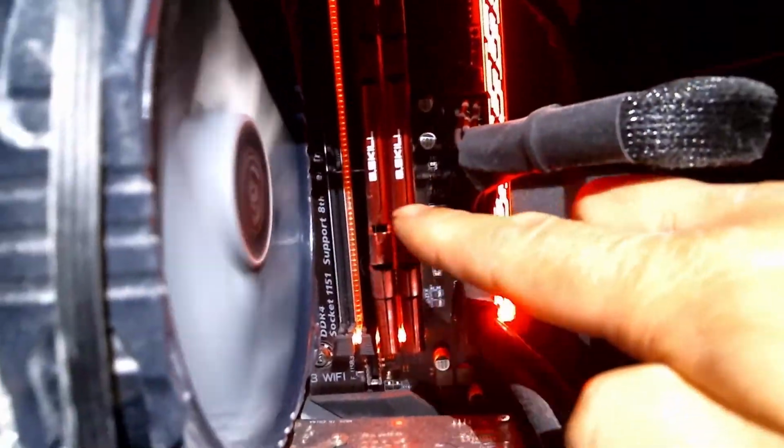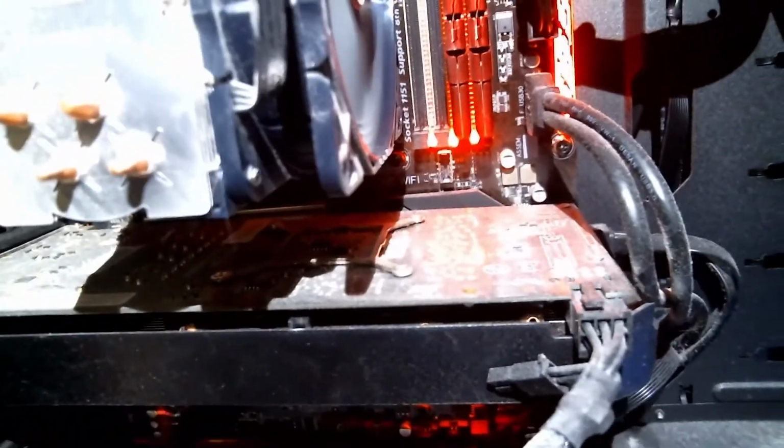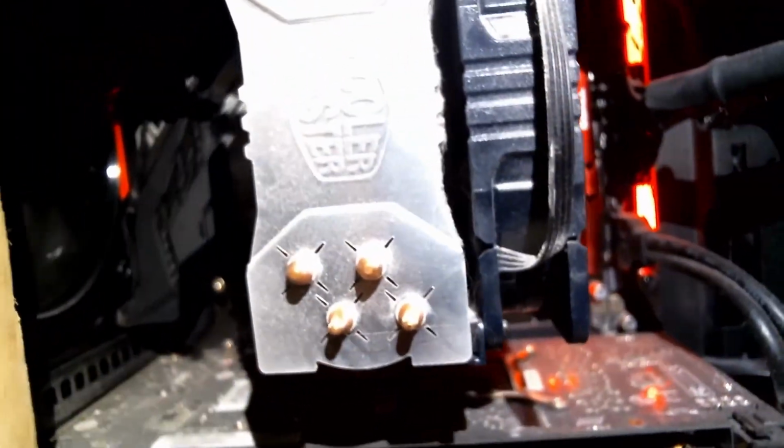Now, these right here, that say G-Skill on them, those are the memory chips. And, well, I can't show the CPU because it's right under the heatsink right there. Okay, what else? Case, cooling fan, power supply. Oh yes, power supply, you can't see it. It's down here, under here. Let me move this over. Here's the power supply. Yes, it's very dusty back here. This, instead of the battery, this thing draws so much power, you actually need a large power supply. Not only does the CPU require power and all the other bits, but the graphics card also tends to take a lot of power too. So you're going to have to decide how hefty a power supply you want in order to keep your computer running.